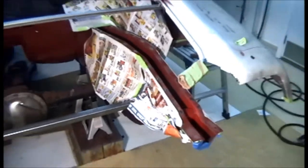Like I said, I'm getting ready to spray my weld through just on those bare spots. It may look a little crazy because I've got that tape taped up, but I really don't want that weld through on the epoxy that's going to be on the outside of the car. That may look a little silly, but the plan is that once the major panel replacement is done on the outside, once I get the quarters back on the car, I'll put the car on the rotisserie and do a pretty good sand on all that's already there, probably sand everything with 180, clean it really good and give it two fresh coats of epoxy on the bottom.